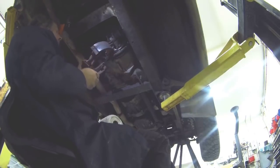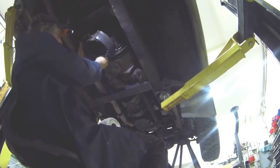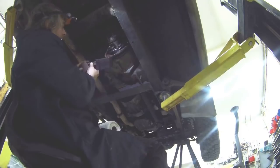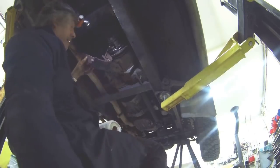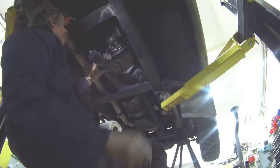And now you can get to the shoes quite easily. So, now we're going to take the springs off like that. Take the spring off, put it safely to one side, and then we can take off this bar at the top like that. Undo the spring, take off the spring, take off the bar, and that's off.